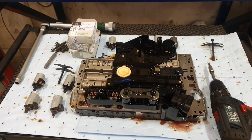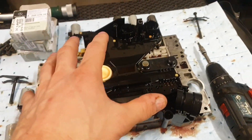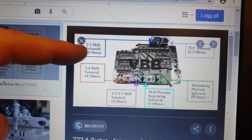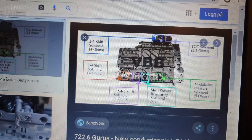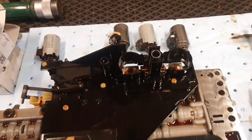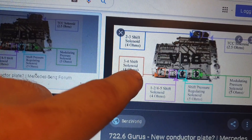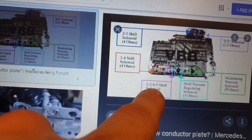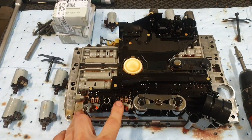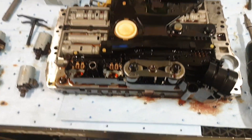Let me switch around the camera. So we're back with the camera the correct way. Now we can have a little overview of what the solenoids are. Here you can see the second-to-third shift solenoid — that is this one. And this is the lock-up solenoid. And this one is the third-to-fourth shift solenoid. And the one on the side is the first-to-second and fourth-to-fifth shift solenoid. These shift solenoids and the lock-up solenoid are the ones that I'm replacing.